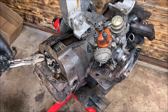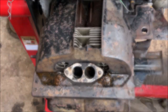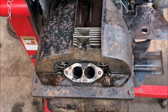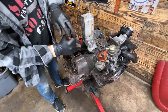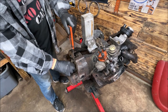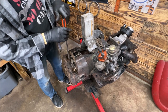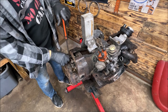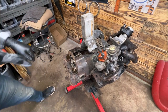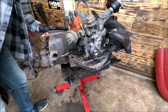Let's bring you up close and just break them loose. That one broke loose easier than I thought it was going to. That one was loose — I don't know why. Let's take them off. I'm going to have to get that oil cooler out of the way. So once you've got them off, don't drop anything down in your intake ports — take little pieces of cloth. I'm pulling the heads though, so we're fine. We have some on the front and back, so let's get to those next. Give these a spray, and there are two around the back.